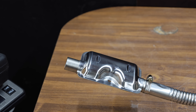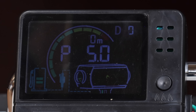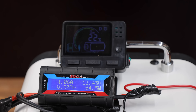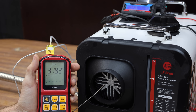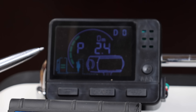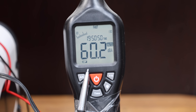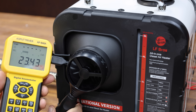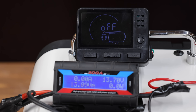The exhaust remained very clean during the entire warm-up cycle. On the highest heat and fan speed setting, it's very close to 74 decibels, and the LF Bros is warmed up in very close to five minutes. It's delivering the highest airspeed yet at close to 41 miles per hour, using a little more electricity than the other three at 54 watts. The air coming out of the vent is the hottest yet at 326.1 degrees Fahrenheit. The heating element is around 400 degrees Fahrenheit and the exhaust pipe is around 240. On the lowest heat setting, it uses just 13.6 watts and 61.6 decibels. On low heat, around 262 degrees Fahrenheit at the air outlet, and 23.43 miles per hour — the fastest on lowest fan speed. The LF Bros took right at four and a half minutes to run the cool-down cycle and power off.